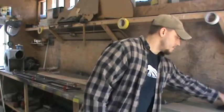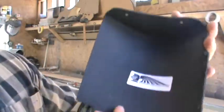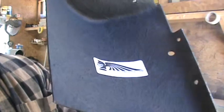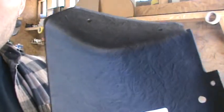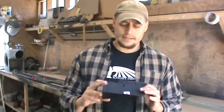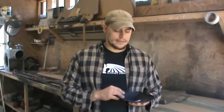I have a ground effect here that's fixing to ship out — maybe this can show you. See how everything is nice and uniform: no high spots, low spots, puddles, or duck tails. No fibers that aren't wet — everything's wet and done. When I was in the body shop, we finished all the insides of our parts — fenders, trunk lids, everything got jammed. I've carried that over. I like to see the backs of parts finished, so I sand all the backs and prime them in black primer before I send them out. I like to think that tells you guys I spent the time on the part to make it worth your while. You guys spend a lot of money on this stuff, so you should get something nice.